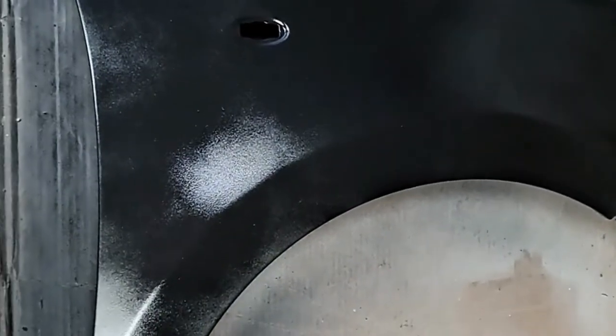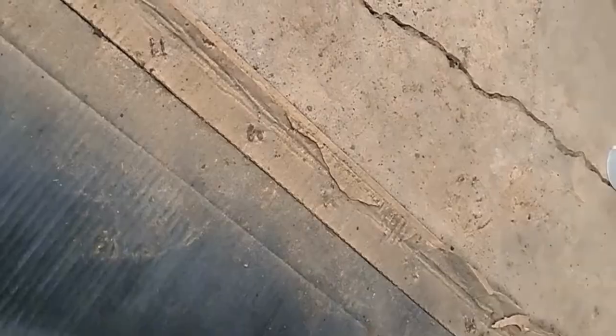Probably the final coat of lacquer going on now. I always try to put it on when it's a little bit tacky — just touch the back of your knuckle and if you feel a slight tackiness, that's the best time to put lacquer on because it'll bond to it. Do a test patch first, then give it a good spray. It will look patchy whilst it's drying. Leave it 24 to 48 hours and then pop it back onto the car — it'll be much easier polishing it that way. Give the last coat quite a lot to get that extra shine, and don't spray in one area for too long or you'll get runs.